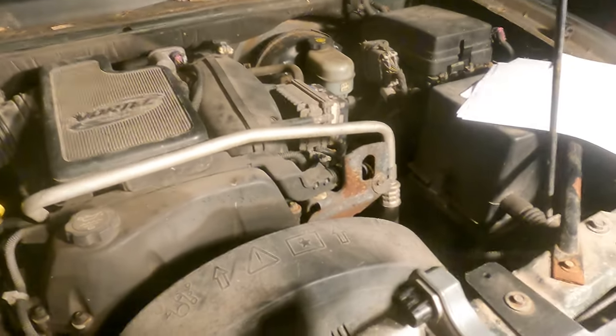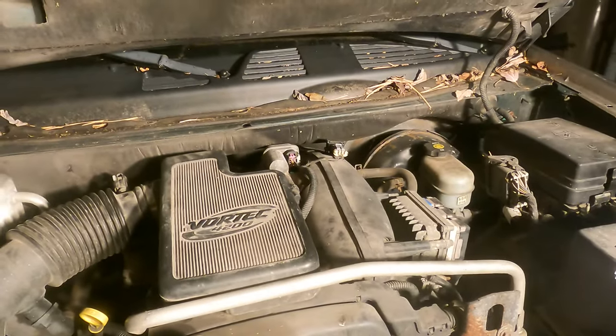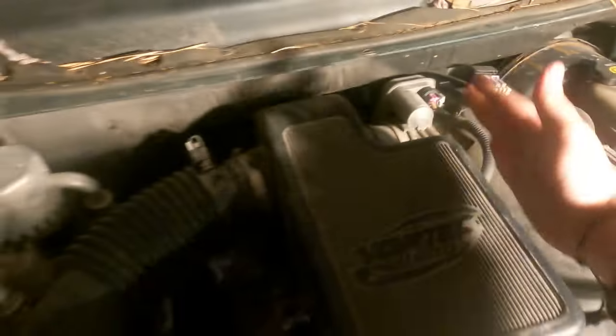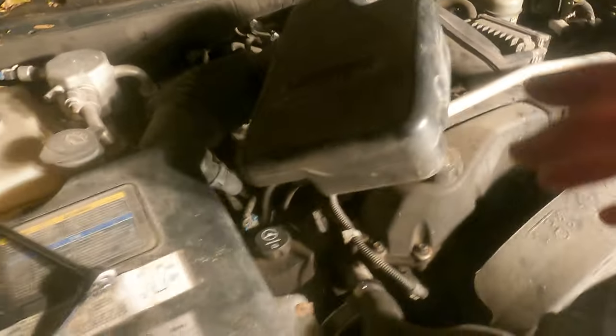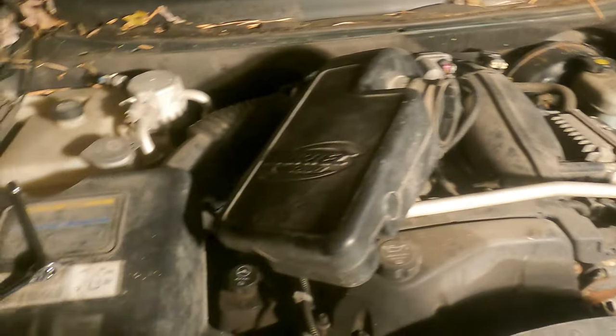The testing can be done with the throttle body still in the car, but I'm going to pull it anyway. To remove it, there's a 10mm bolt here and a 10mm bolt there, and then I'll loosen a flathead to pull the whole airbox back so I can get up in there. I'll also unplug the sensor so I don't accidentally damage it. Once you have those two bolts and this piece loosened, come to the passenger side, pull it this way — it'll pop off the throttle body assembly — and you can lift it up and tuck it back.